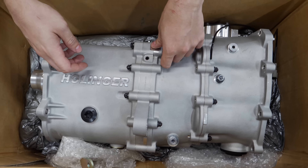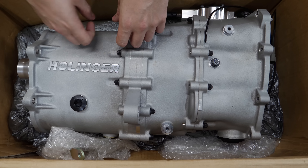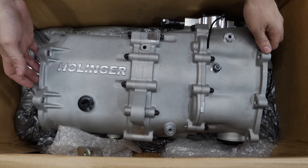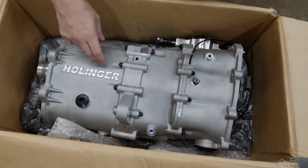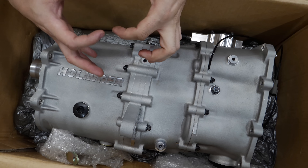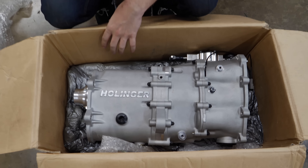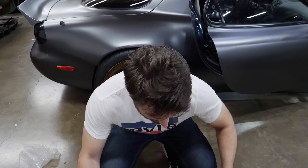That is a transmission capable of handling a ton of torque. I picked this for a couple reasons — one of them was that the transmission on the Hoonicorn was not capable of reaching both the wheel speed and the torque I was going to need on this car. The RD6 is capable of both. I have a custom gear set in here, but like most transmissions, fourth or fifth gear on this one is one-to-one, meaning what goes into the transmission comes out at the same speed.